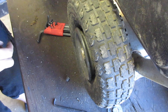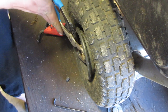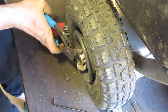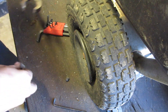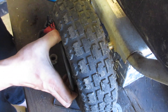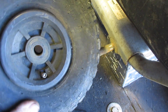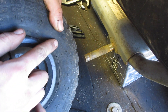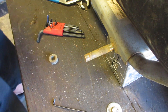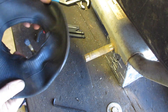I'm pretty confident on my deduction on that one. Now that the engine works, I think it's time we pay a little attention to the wheel. Now this is on a block — it's not very tall. When you find a tube, basically you look for these numbers right here. This is, for instance, 4.10/3.50-4. Type that in and you'll find yourself a tube. Luckily I did that and now I have one, so it's time to take this apart.